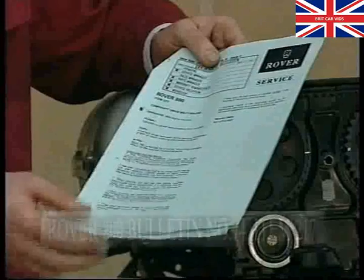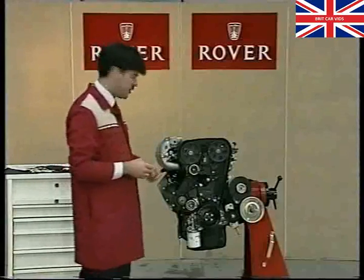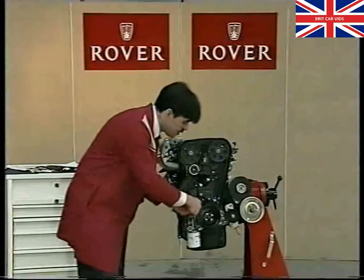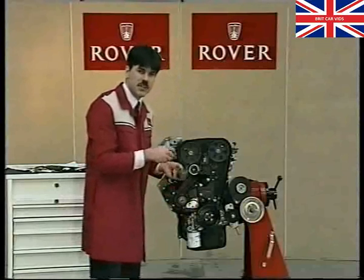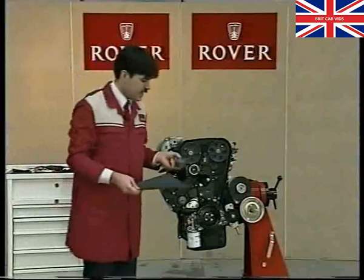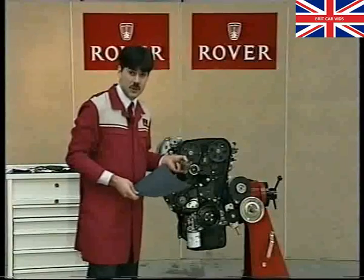What we've come up with in this bulletin is a completely revised tensioning procedure and a little bit of a service fix to carry out on the tensioner pulley. The fix to the tensioner pulley: one of the reasons why the belts were being set over slack was because this hardened ground finish on the back of the pulley was causing the pulley to slip as the clamp bolt was tightened. The way we get around that is quite simple — we place a disc of P220 wet and dry paper behind the pulley, and that provides some resistance as you tighten that bolt, and thus prevents the pulley from slipping.